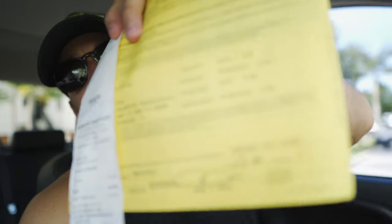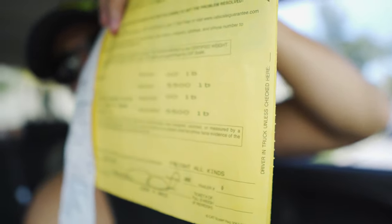Give or take 12 and a half gallons missing, that's about 96 pounds — we're going to round that up to 100 pounds for easy math. I was also not inside the truck when it was weighed. The truck weighed in at 5,500 pounds. Add the missing fuel — another 100 pounds — that makes it 5,600 pounds on a full tank. Then including me, which is about 170 pounds, you're talking about 5,770 — almost a 6,000-pound truck.